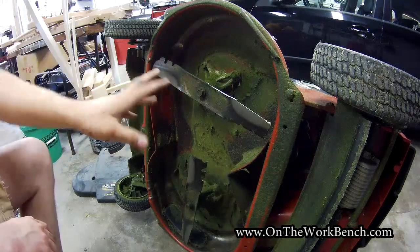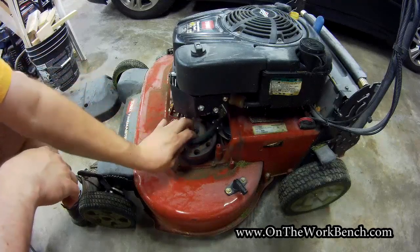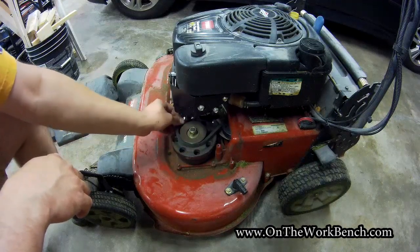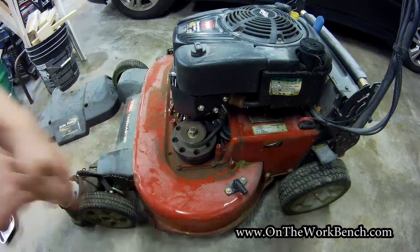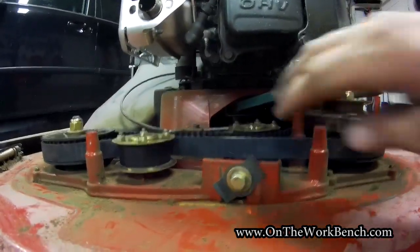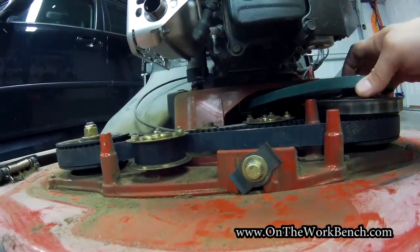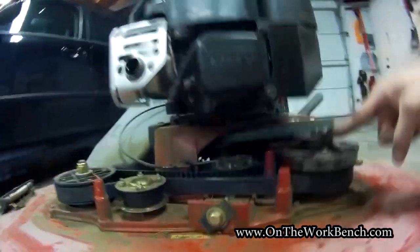Now that I've verified the timing is correct, I'm going to flip the mower back over. With the mower flipped back over, the belt from the engine still needs to get reattached. I might have too much slack there, so I need to double check. Because this belt is actually off the pulley — looking straight back, there's a little blade guard and the pulley is right back behind that — I'll need to flip back on its side to make sure I get that belt around the pulley before securing it in front.